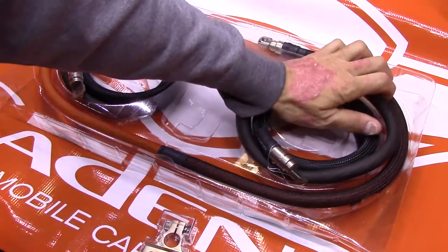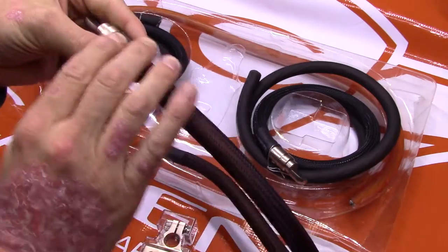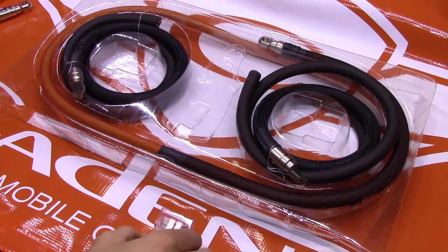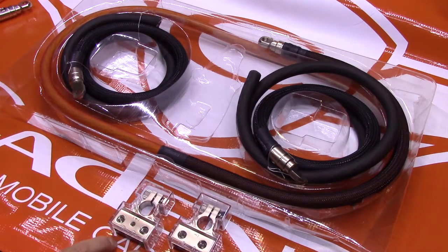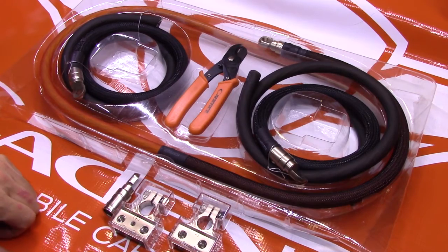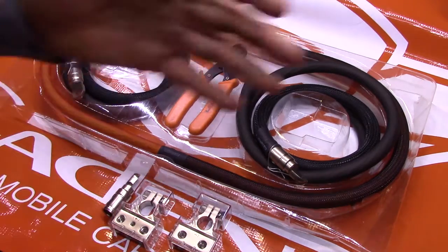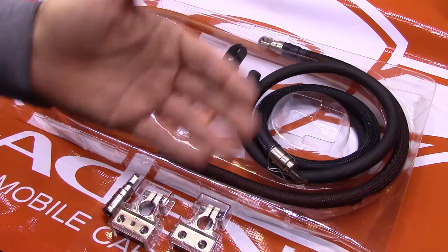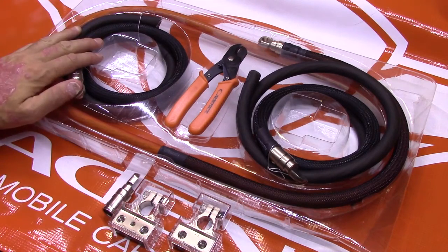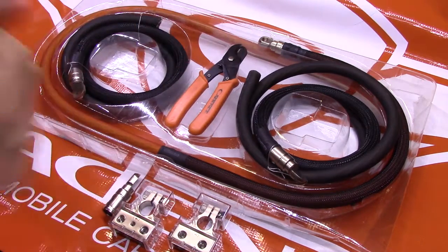Last but not least in the kit is going to be the power connection here. This is an upgraded power connector from the alternator to the battery itself. The main reason you want to use this kit and all its components is to give yourself a fighting chance at current, because current is really, really important. If your voltage drops in the car, your current increases. If you can't supply the current, the equation collapses, and your amplifier that says it's 1,000 watts is actually only producing maybe 500 watts because it can't source the current from the front end of the car.